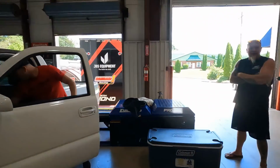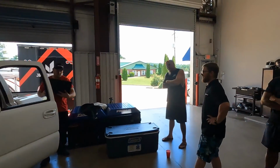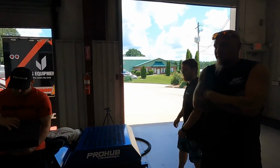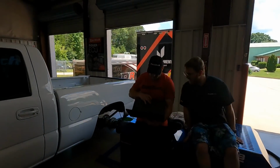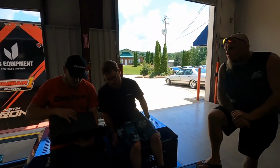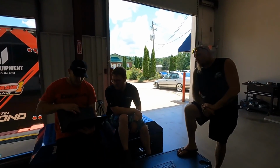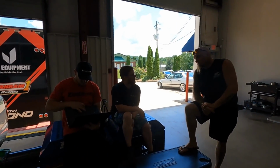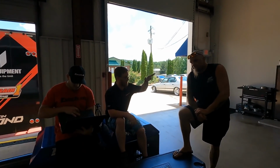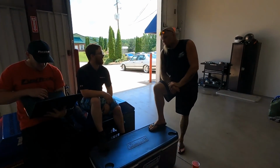You can still nitpick it, but why? That's still only 25 pounds of boost. But hey, stock block, how far do you really want to go? Yeah, exactly. 25? It hit 23. It spiked early. 24, yeah, 25 for a little bit. And up at the top the rest was 23. On the gear changes, when it drops in RPM, it doesn't have quite enough RPM to keep the exhaust going, so it has a little belly to it. But that's more than plenty for having fun on the street.